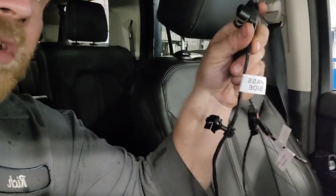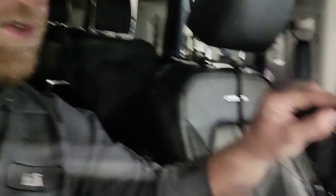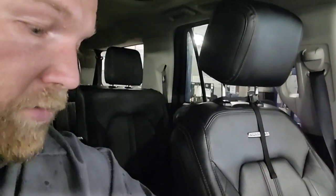What I found under the seat is this purple and black connection. There's a faulty connection at this purple connector. I could wiggle it and the video would come back, then it'd go away, come back and go away. When I looked on the opposite side of where it actually hooks in, it's actually labeled on this connector. One side says passenger side, one side says driver's side. So the passenger side connects under the seat on that side, and the driver's side connects under the driver's seat.